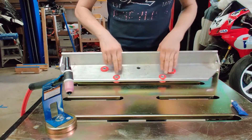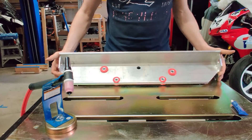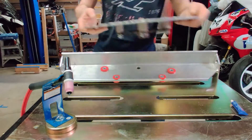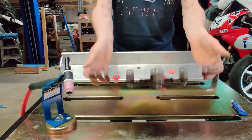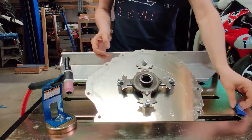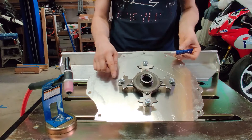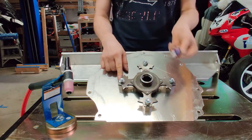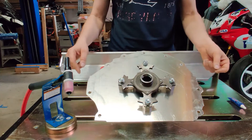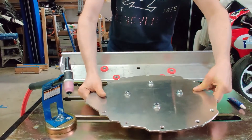This is done, and the bushings are already in place — four of them. The next piece is the bell housing cover with the locking mechanism already in place. I used hardened bolts with split washers and high-strength thread lock — definitely don't want this coming undone while driving. Both pieces will go together like this.